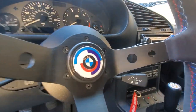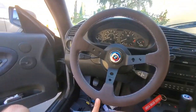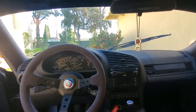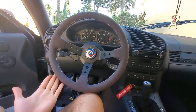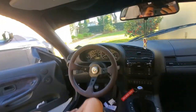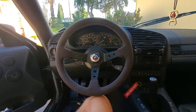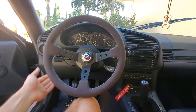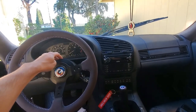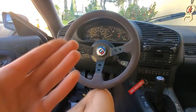It looks great and the horn works too, but my car is off right now. They're matching — I'm happy with it. The color you're seeing isn't accurate on camera — this is actually black Alcantara suede, not purple or brown. If you have Alcantara on your car you know how it looks. Thank you for watching, hopefully it helped — any questions just drop them below. My turn signal cancellation works automatically with the NRG short hub. People said you can't do it with the short hub — no, it works. You just put it in the same way but modify the holes a little bit, as I showed in the video. Thank you so much and that's it.